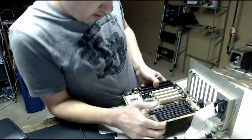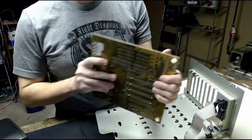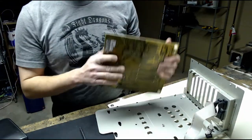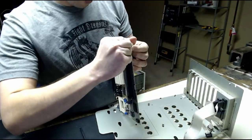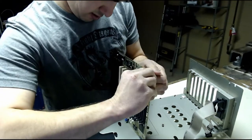The old board is removed. So, on a lot of these cases, these old boards had these little plastic pieces here that clip through the board, and those slid onto the little pieces in here, and then you screwed the rest on. So there are a few standoffs here that get screwed into, but these also did part of it, so you have to squeeze the plastic here to get these suckers out. There we go.